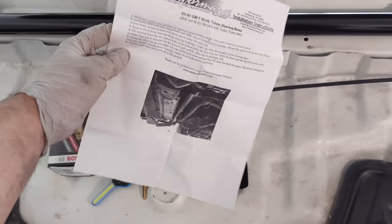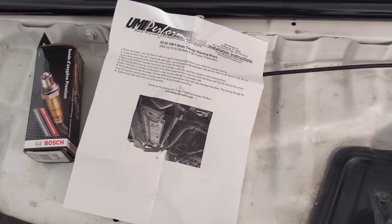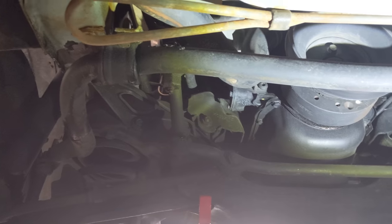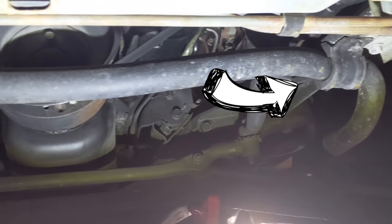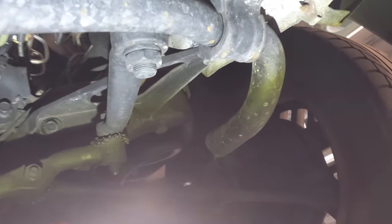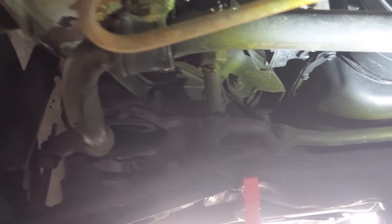It's really easy to install this Wonder Bar. You get them from various different manufacturers, and you can make it yourself if you're good with a welder. Here you can see the stock sway bar that's in there - it's pretty thick, which is part of the WS6 package. Basically where it mounts to the frame, there are a couple of bolts - you just loosen the bolts, shove the Wonder Bar in there, and tighten the bolts. You don't need to modify anything, no special hardware, no cutting or welding. It's one of the easiest installs you can do, and it makes a big difference.